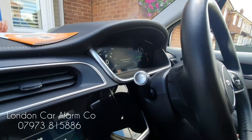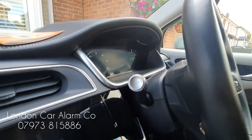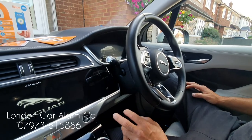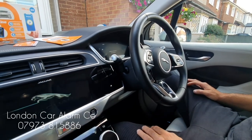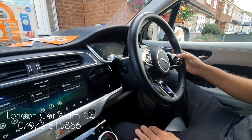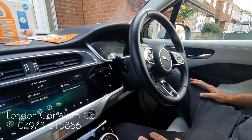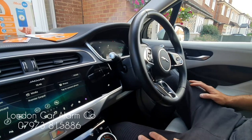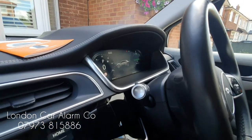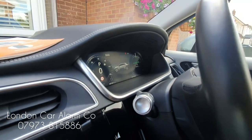If the vehicle won't start it will swipe and then switch off. So now every time the customer jumps in the vehicle, he does not put his foot on the brake — he turns the ignition on, main ignition on, goes through a push sequence — which was just set for a video — so one, two, three, waits for a melody, then starts the vehicle. You can see we've gone to ready, so the vehicle is now up and running.